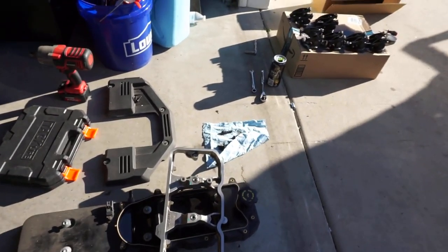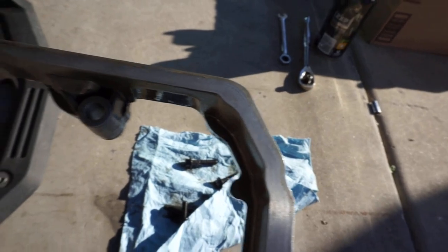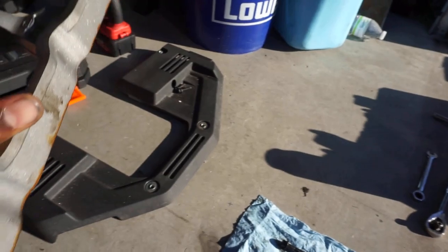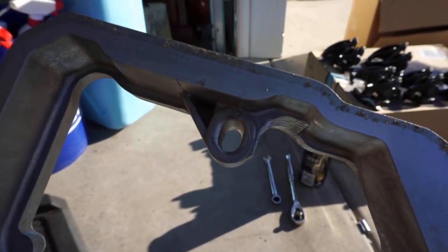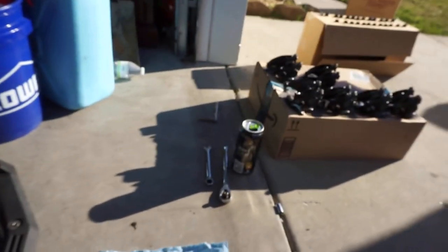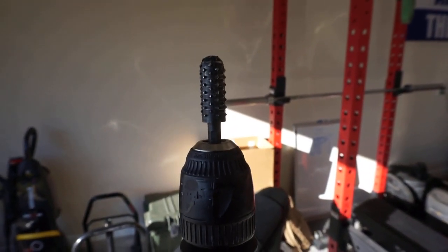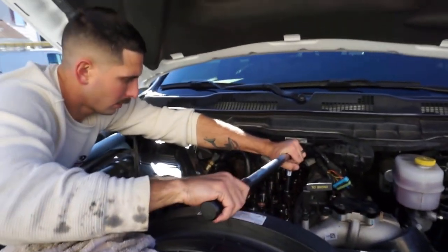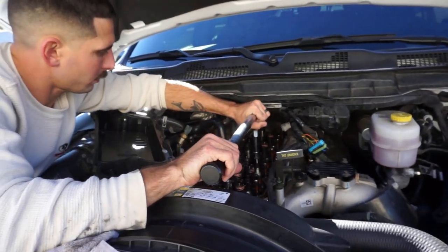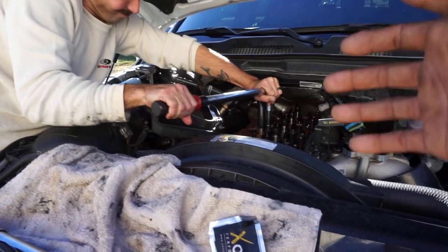That was the last one! One thing I forgot to mention — you will have to shave down the rocker box. Right there you can see — we shaved it down because it protrudes out. You have to shave that back so the number 24 stud can sit down in there correctly. I used this funny-looking drill bit I picked up from Lowe's when I did my head studs — it carves it out in a heartbeat, takes no time. Now he's going through and doing a one-click on all of them just to make sure none of them move.